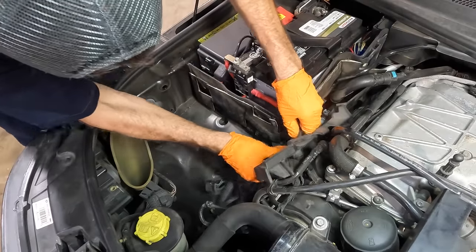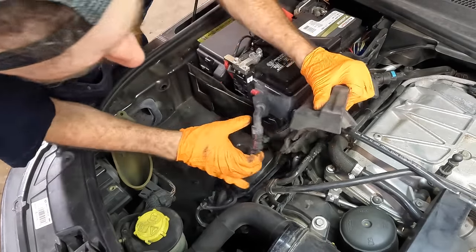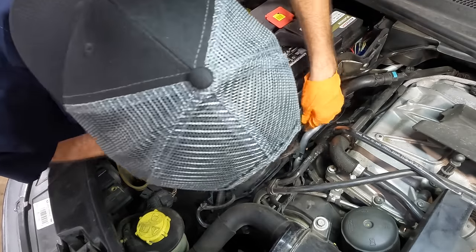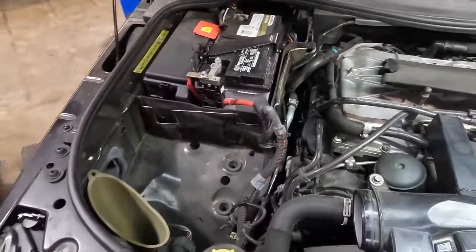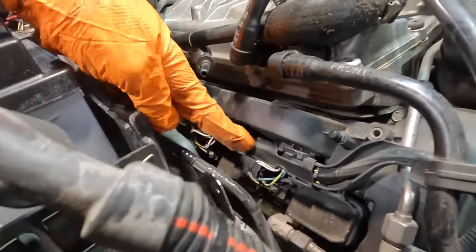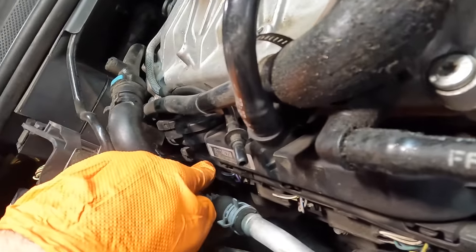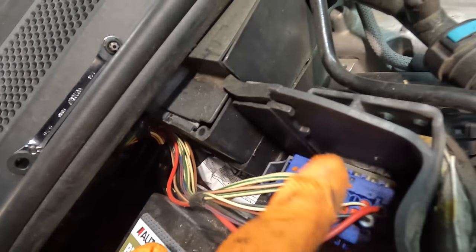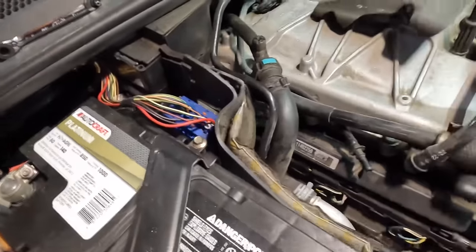We've got some evap hoses to disconnect here. Let me disconnect this and set this guy aside. Wiggle this little cover thing out. Maybe I can do these plugs without pulling this battery tray out — I've never done this job before. I'm trying to see what I can see, which isn't much. It's a coolant line, I don't want to take that off. Why are we stuck with no space? I'm supremely confident that I need to start pulling some of this stuff apart. I've got to remove this harness bracket so I can reach the bolts on the coils, and there's no way I'm getting to that last spark plug without pulling at least this panel off.